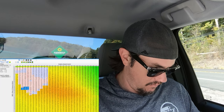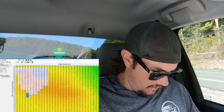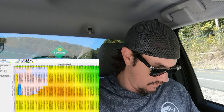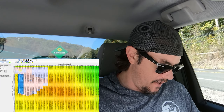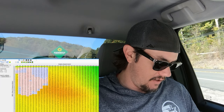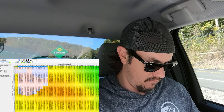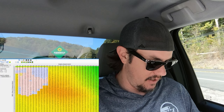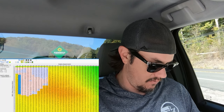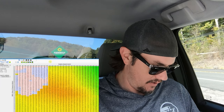Blend in between these two. I'm going to leave that one kind of as it is and see if it cleans up — shouldn't be too bad there. Bring these down. Then as I said in the past, one of the best things that you can do if you can't blend into the first cell here — you're not going to be in 400 RPM — so just come down here and you can do the same thing for this row. Copy this row and paste it right there so there is no transition in that area that we're not hitting. Same ordeal with this one — come in here, copy this row, fill it in here, maybe to about there, and then we'll do a blend on the transition here. Actually, not bad — I like that one.